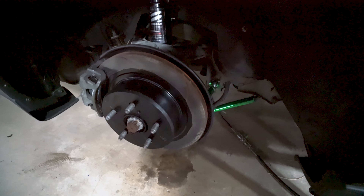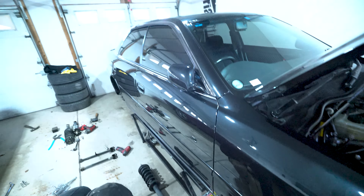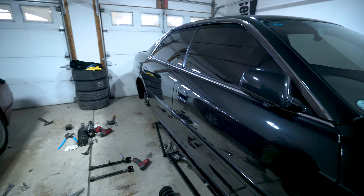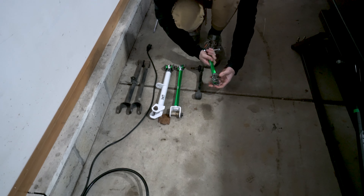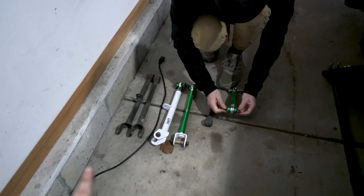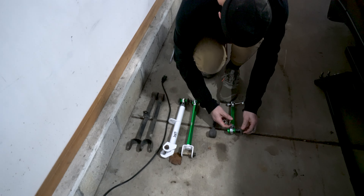We're back — got Josh here and we already knocked out this side, so all the arms are in and coilovers are in. I see the rear lower control arm still needs doing, so we're just going to knock out the other side. We're setting the arms close to OEM and throwing them in; only one needed adjusting. I'm sure my alignment is gonna be pretty messed up, but we're trying to get it close enough so I can drive it tomorrow to get it aligned.